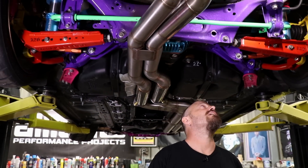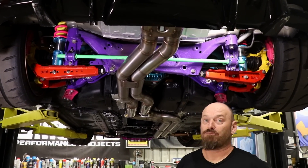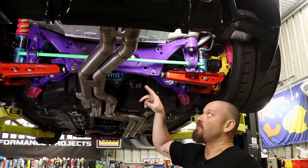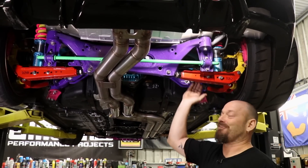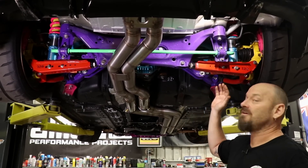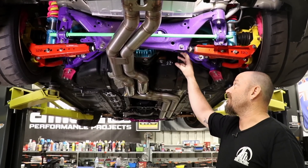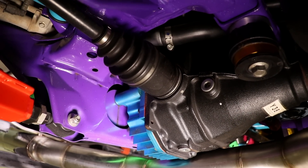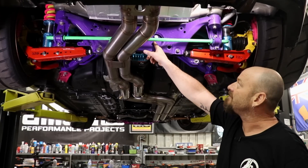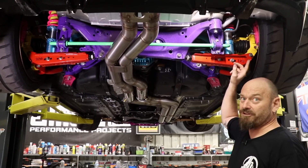Heading towards the rear, there's a lot going on here — it's quite a spectacle. The lads actually did all this prior to the car coming anywhere near me. It's very colorful but also very functional. There's a lot more going on than just pretty colors, and it garnered a lot of interest on Instagram when they did the rear end. The reason they had the whole thing out is that the car was so low that CV joint failure was occurring because of the angles of the joints. So the diff has actually been raised up into the floor with sections removed from the subframe to straighten out the driveshafts. The big bushes have been plated in, the whole offset changed to lift the diff up into the floor. Big 326 Power rear brakes.